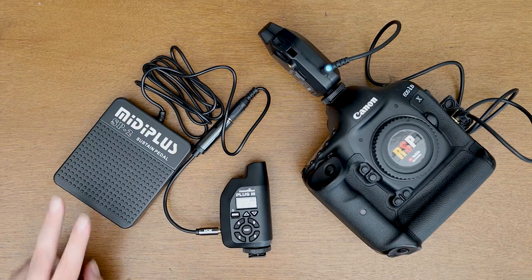There is one way this could be improved. If you leave your camera for a while it goes to sleep, and when it does, the first press of the foot pedal won't take a photo — it will just wake the camera up. You'd have to press it a second time to actually fire. You can work around this by pressing it every now and again to keep the camera awake. However, you can get a different cable that has a pre-release in the line, which keeps the camera awake. I'll link that in the description too — it's a little more expensive but it would improve the setup.